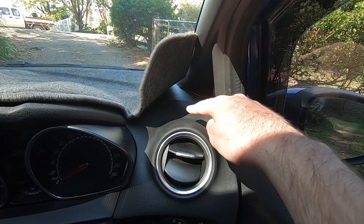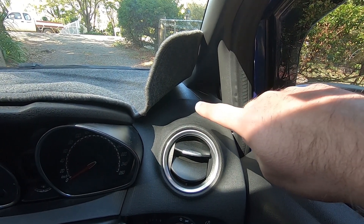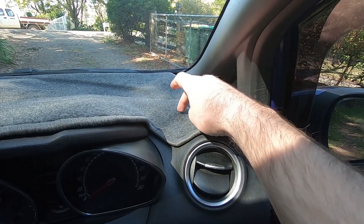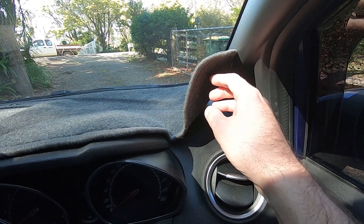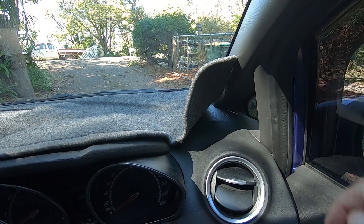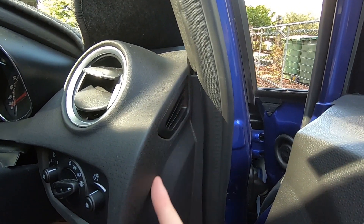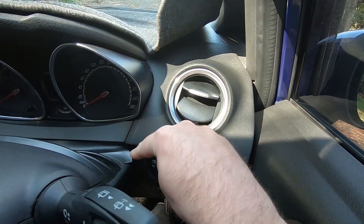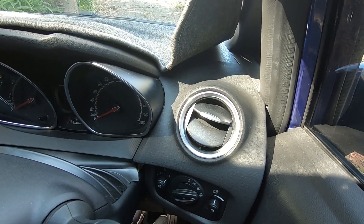This is where I've chosen to mount it. I've cleaned the dash and then wiped it over with some water and dried it as well, just to make sure it's as clean as possible for the double-sided tape. I've got that sitting in the sun for a bit to warm up. What I'm going to do is measure up where the mount is going to come through here and put some slits — and a slit for the cable as well. The beauty of this spot is I can either run it down the side here, all the way down and maybe get under this trim, or run it down here and get under the dash that way as well. I'm going to have a play around and work out which way looks best.